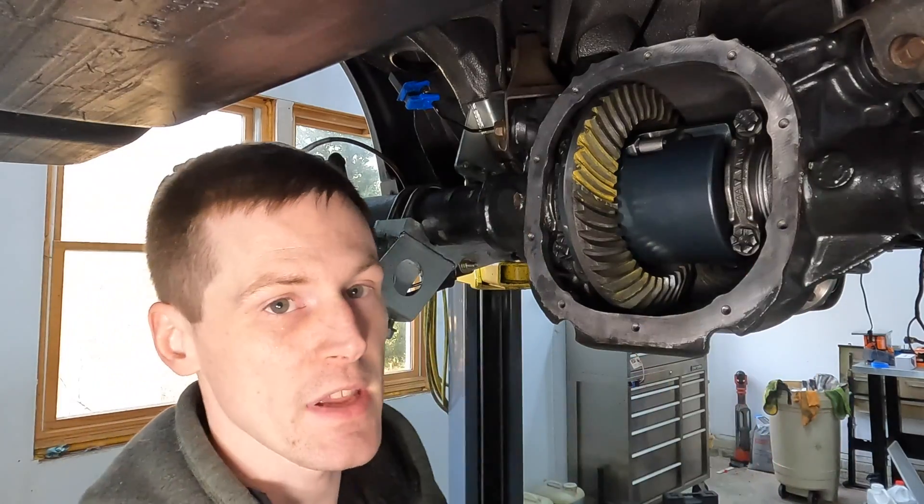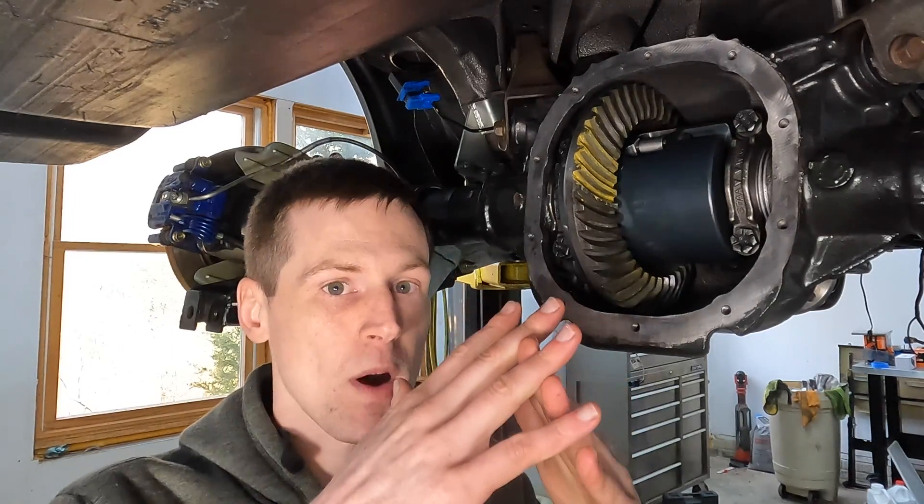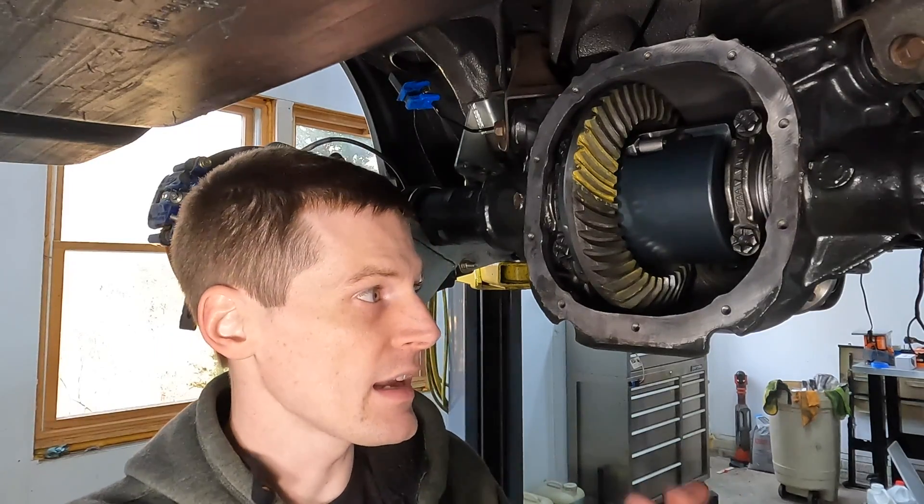If you're using a used set of gears — gears that have already been run in another vehicle — or you're just doing a rebuild and freshening of the axle with new bearings, you really want your gear pattern to be the exact same as it was before you took it apart. After a ring and pinion has been run for more than about 300 to 500 miles, that set is now matched. If you try to change that wear pattern, you're going to cause noise. The pattern when you reassemble needs to be one and the same.